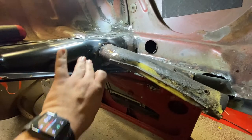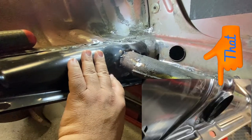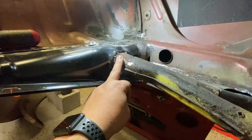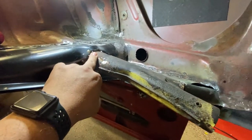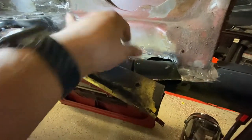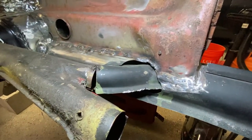Basically, you want to grind. There's a lip on this rear crossmember — grind it flat. And I took this piece here, it's kind of like an oval piece, and I fit it up there along with the heater duct itself and see if I can match it up with this here.